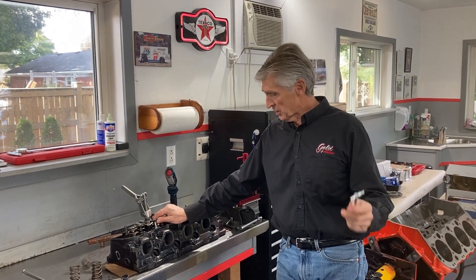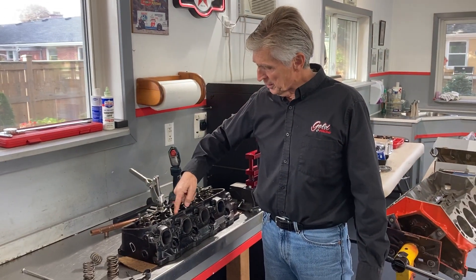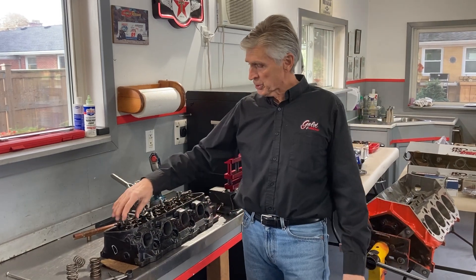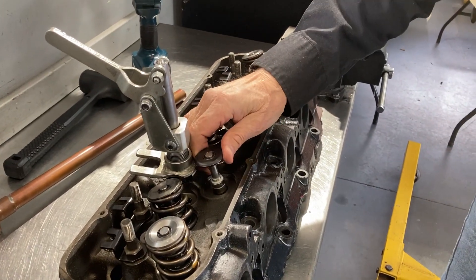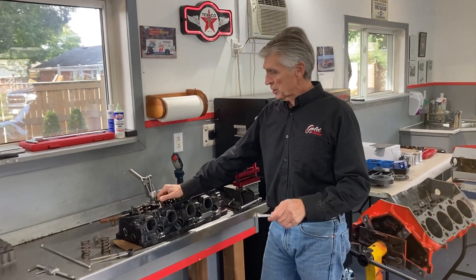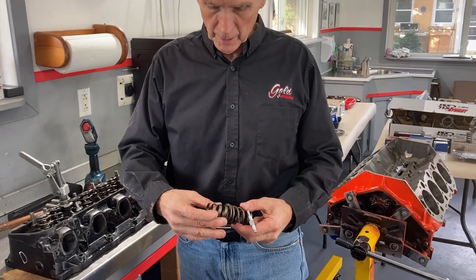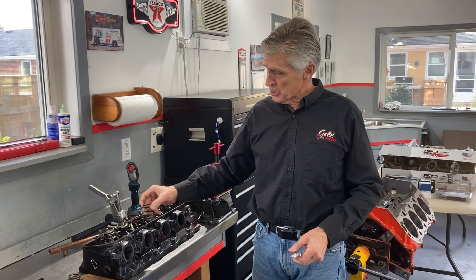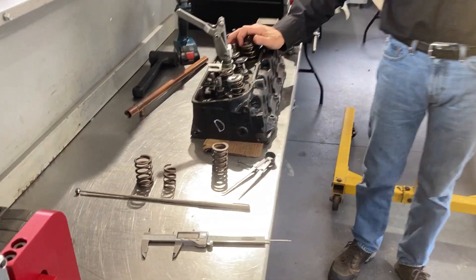The first thing we need to know is what it is right now. Because this engine had bigger valve springs before, the base of the spring seat was machined down deeper. So these springs are installed at close to two inches installed height, which is going to work in my favor. For the break-in of the flat-tappet cam, one way I'll reduce pressure on the cam is by installing the springs without any shims at the full installed height — almost two inches. I'll also remove the damper from the inside of the spring, and that will reduce my spring pressure at open to under 250 pounds.